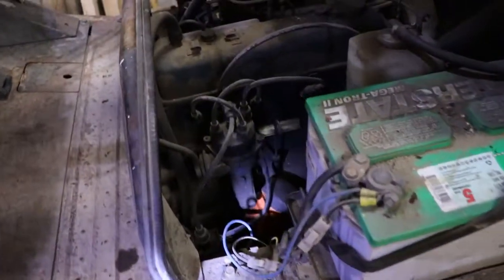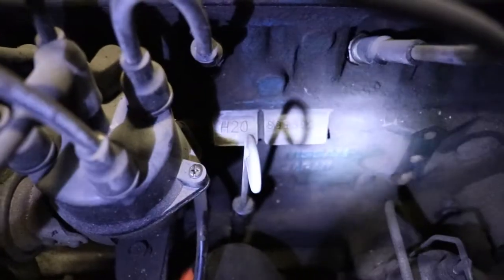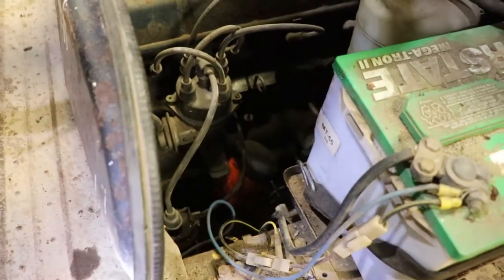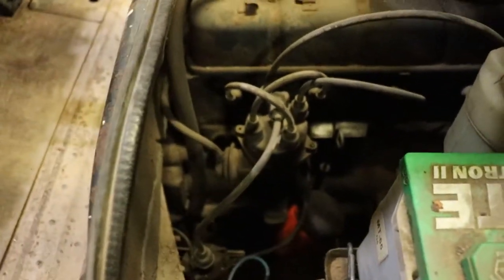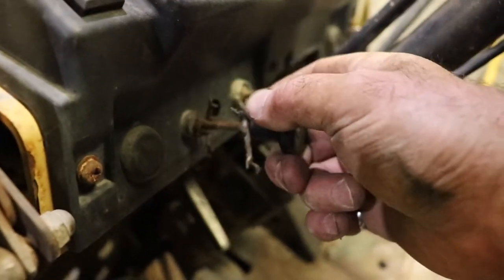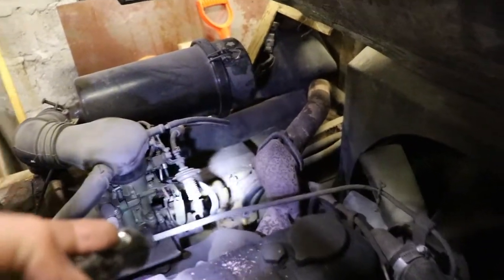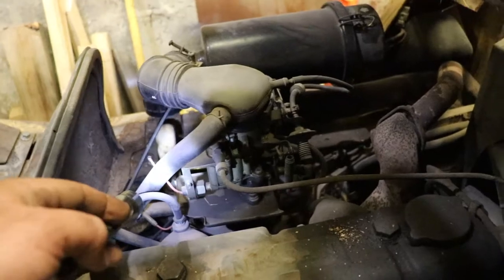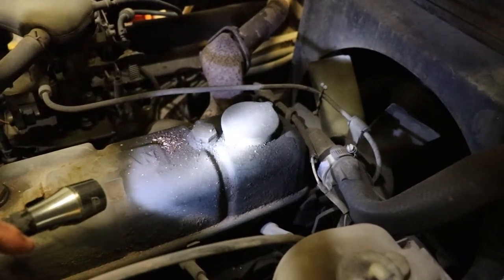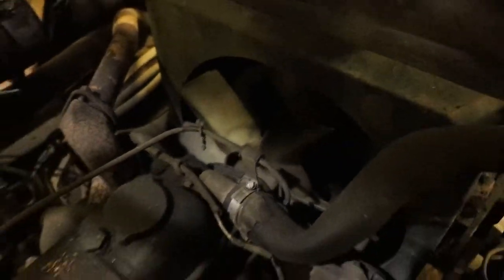Take a look at what's going on in here - it's missing a bolt off the distributor right off the hop. There's the Nissan H20 engine. It smells a lot like gas and I think I figured out why - it's got a choke here which is like an auto reset choke, but somebody had wrapped a bunch of wire around it so the choke is like always on. That's kind of crazy. There are some electronics on here - I think there's a fuel cutoff valve or something. It doesn't look like anybody's put oil in it in a long time. Belt's original, so I'll have to change that.